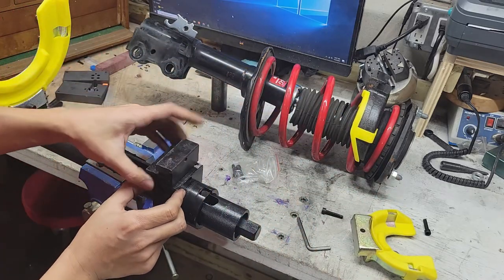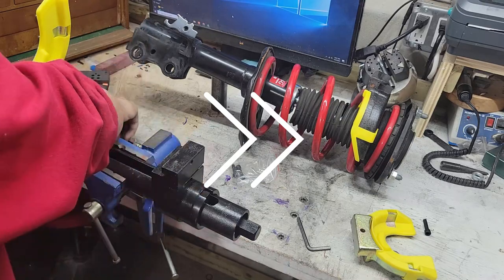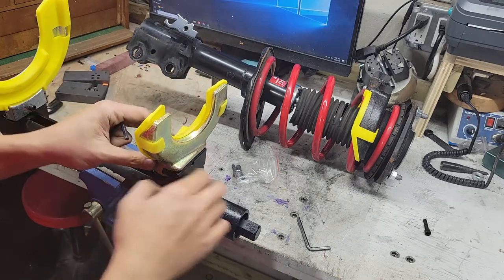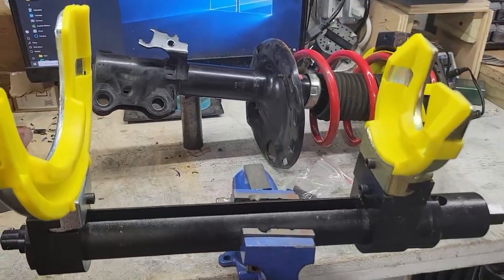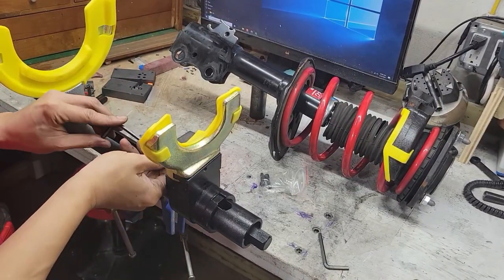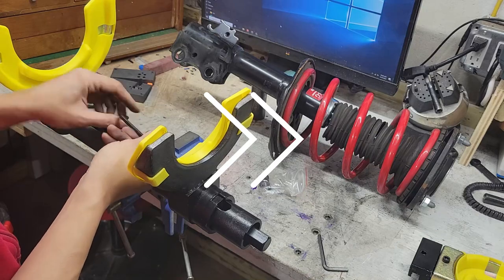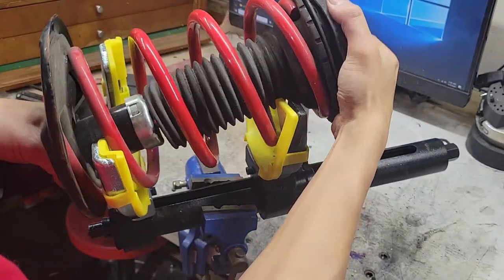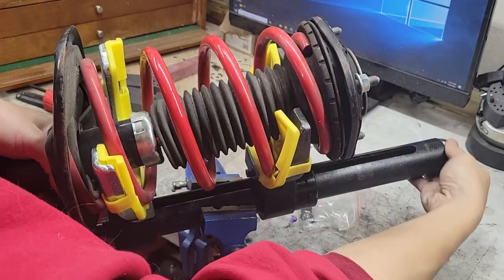Take the end with the narrower edge and bolt it onto the compression rod. Then take the small yoke and bolt it onto the extension. You can see how the extension would help keep the spring parallel to the compressor. Let me take this off so I can put the medium yoke that I need on here instead. I've sized this up so the spring will fit inside.